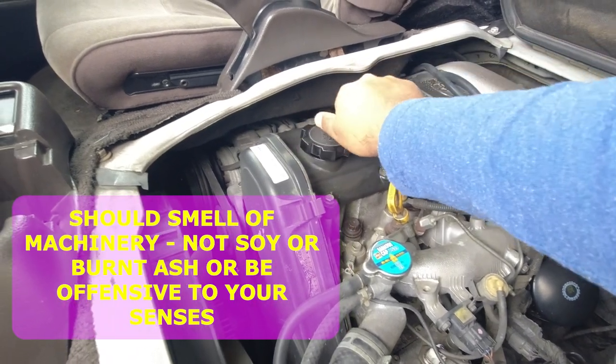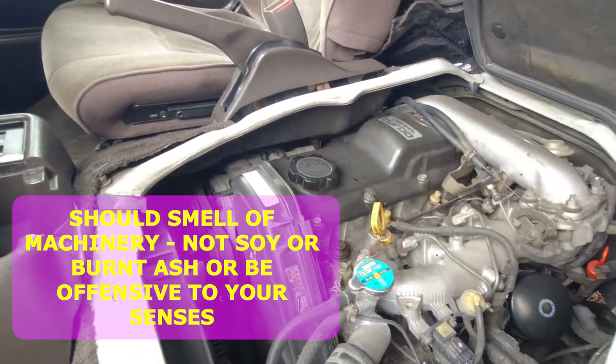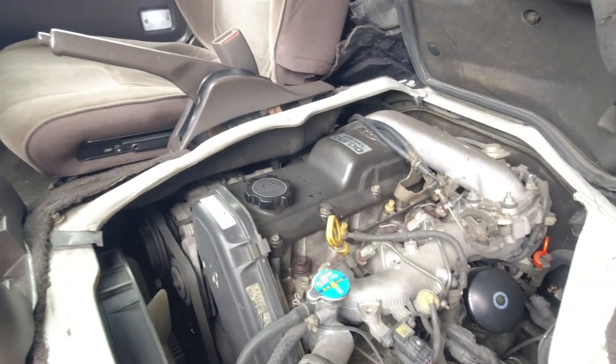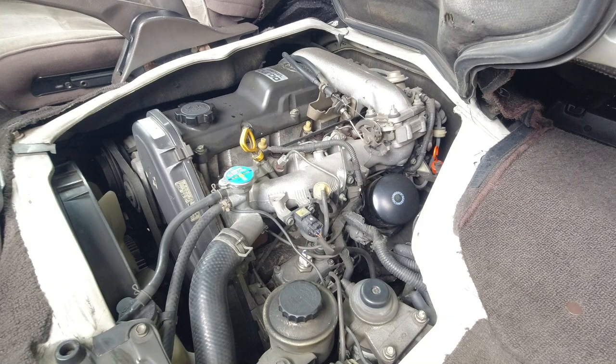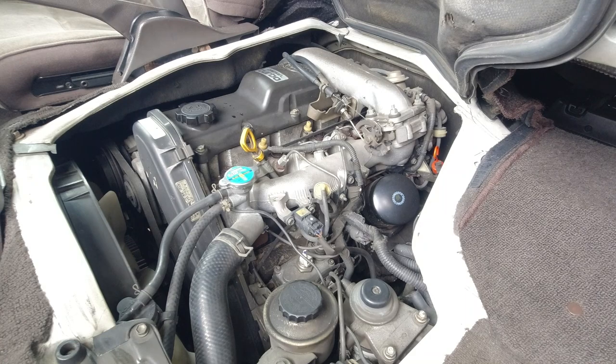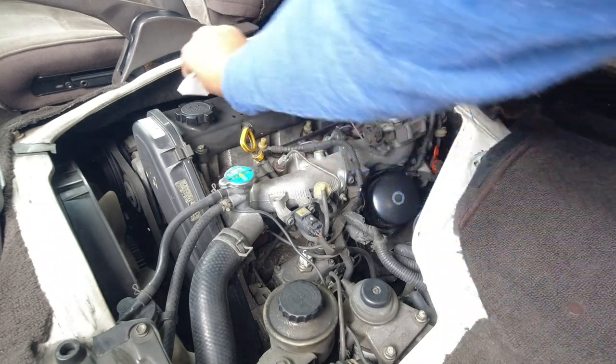It's okay for diesel engine oil to be black. It doesn't have to be black, but it's okay for it to be black. Now you can get rid of that black engine oil sensation inside your engine just by doing two engine oil changes within like 2 hours of each other. So you're basically carrying away all of the soot inside the engine so that all that's left is clean engine oil, and it will stay clean for the entire duration of the service interval. I haven't done so on this one yet, but I will be doing it eventually.